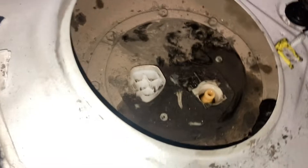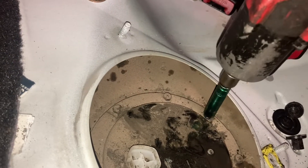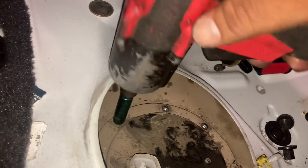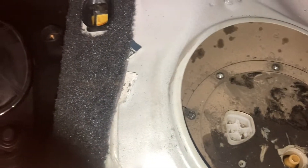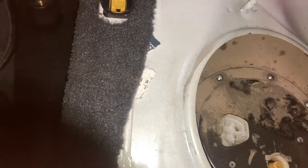I'm going to try to run the surge on the OEM pump in the tank, at least for now to get it started, and then I can discuss with my friends about further modifications. You'll remove everything with the 8mm all the way around the tank. Once you remove the hardware you're just going to go ahead — oh, I missed one. We're going to move this over here and end up cutting this off later since we are going to be running all new lines for like a real race car setup, so I'm doing this a little differently than a typical fuel pump install.